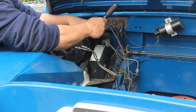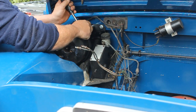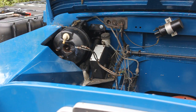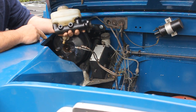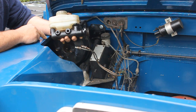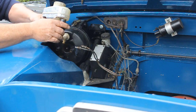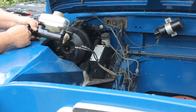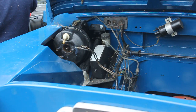Now there's one last thing I wanted to show you while I've got the bonnet open. You'll notice that while I've been doing this the master cylinder has been off the brake booster. I'm re-kitting it at the moment, so I'm just waiting for the kit to arrive. I've painted it up and on the other side, take a look at what I've done — I've covered it in self-adhesive foil tape. Here in New Zealand we have a huge problem with these things getting a big strip of sun streaming in between the bonnet and the top of the guard, and it literally cooks the plastic. This just reflects the sun away and makes these things last forever, because if you don't, you can't just buy the reservoir — you have to buy the entire master cylinder.